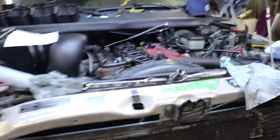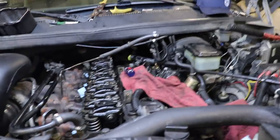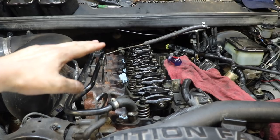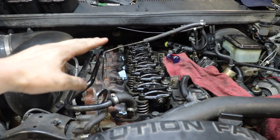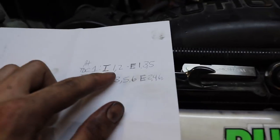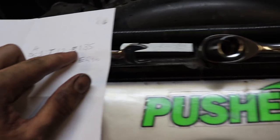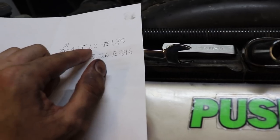We're going to get those done and then get to the fun part — the injectors. I did get all the valve lash done and set, and I think it turned out just perfect. Right now it's set on top dead center for cylinder six. I've got a little diagram I pulled off a Google forum. When number one is on top dead center, number six is at crossover — the back rocker is just starting to go down and the intake is just barely starting to go up. When TDC is set on number one, you do intake one and two, exhaust one, three, and five.